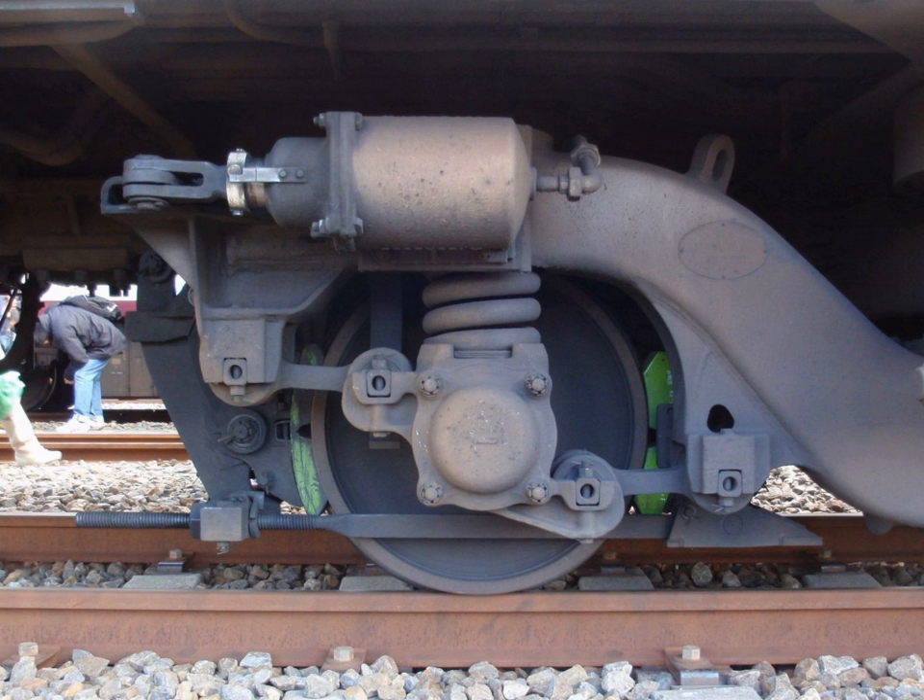In a way, Watt's linkage can be seen as two panhard rods mounted opposite each other. In Watt's arrangement, however, the opposing curved movements introduced by the pivoting panhard rods largely balance each other in the short vertical rotating bar. The linkage can be inverted, in which case the center P is attached to the body, and L1 and L3 mount to the axle. This reduces the unsprung mass and changes the kinematics slightly. This arrangement was used on Australian V8 supercars until the end of the 2012 season. Watt's linkage can also be used to prevent axle movement in the longitudinal direction of the car. This application involves two Watt's linkages on each side of the axle, mounted parallel to the driving direction, but just a single four-bar linkage is more common in racing suspension systems.